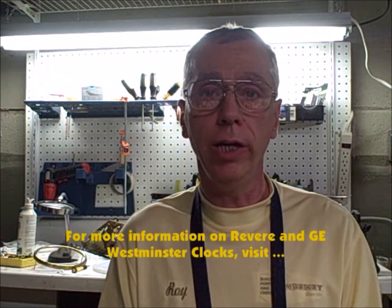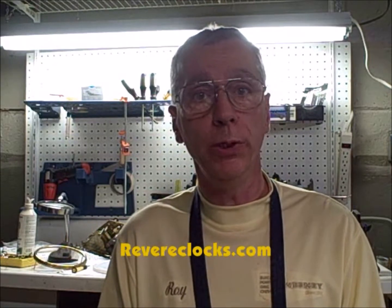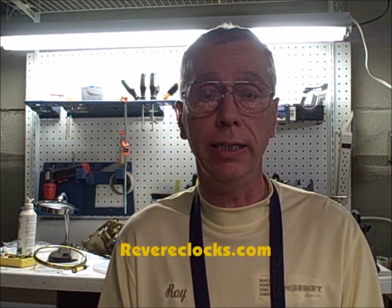In this video I'm going to show you how to take the movement out of almost any General Electric or Revere Westminster chime clock. And afterwards I'm going to show you how to properly take the rotor out. Now this video is going to cover movements made between 1933 and 1960.